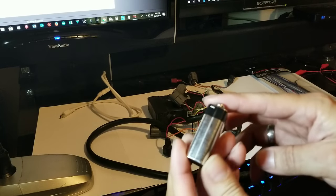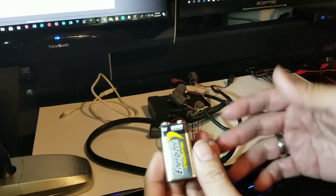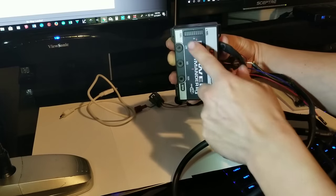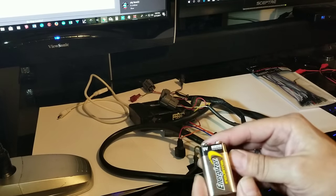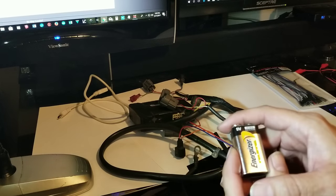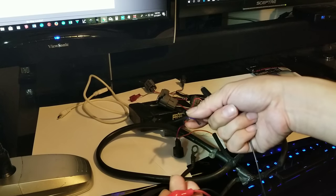To connect power to the power commander you need a 9-volt battery. Make sure your 9-volt is good — a lot of people on YouTube say their unit didn't power on, and it's just a dead battery. I did the same thing: I had a battery sitting around for years, plugged it up, and nothing happened. It only had 1.7 volts. When you plug it in correctly, you'll get an LED flash that then stays solid at the bottom of the unit, confirming you have power.